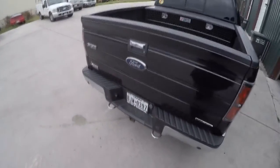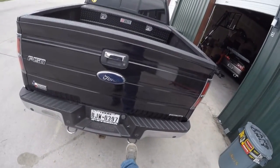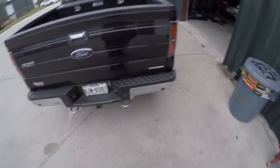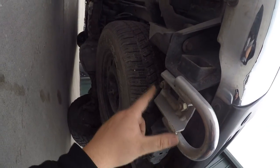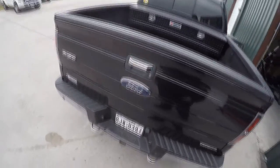For the mods, I got these front bumper hooks — about $70 on eBay. I cut my own bracket, got some heavy 10.9 bolts, put them on with thread locker. These things are solid — I've yanked people out of the mud with them.